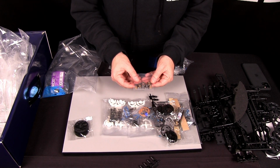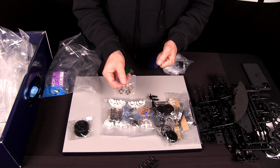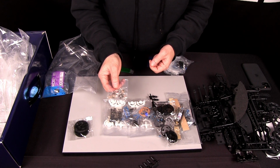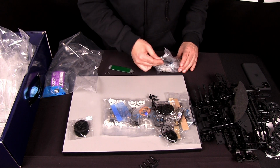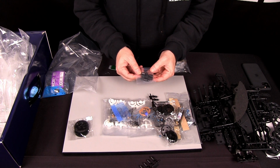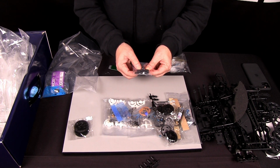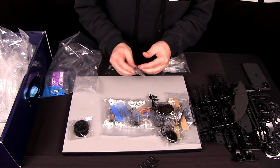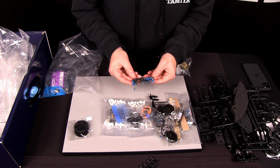We've got some ball bearings. Oh, there is a couple of bushings. The bushings are probably used in the steering rack, which can be replaced with 8x5 bearings if you so choose. Some more spacers. We've got the steel outdrives to the differentials. You can replace these, link in the description, with some aluminum ones. So that's cool. And some hardware.